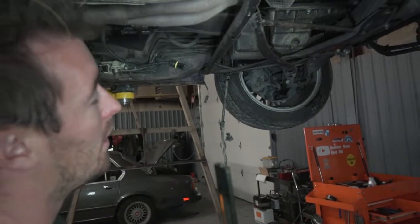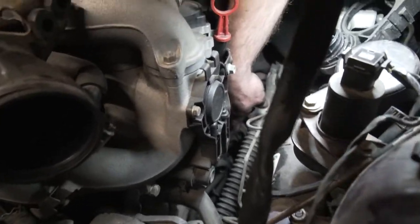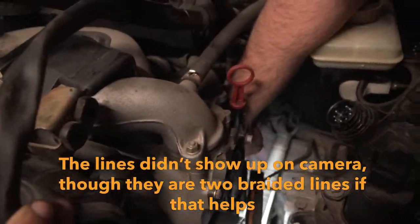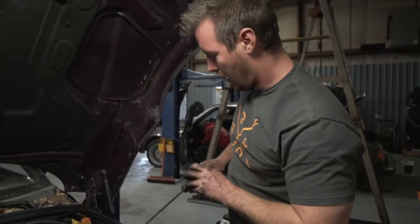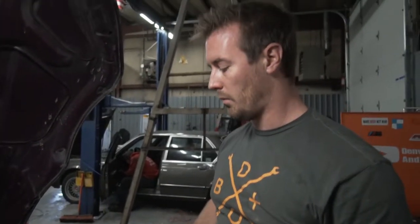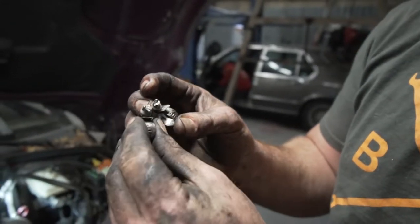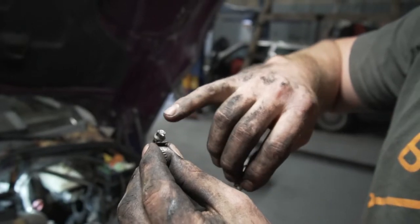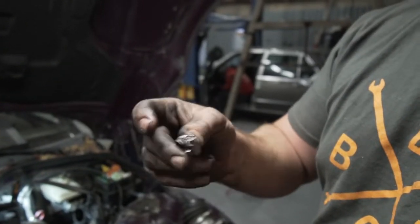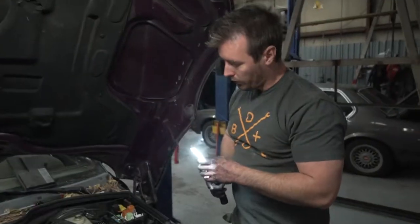Now that we've got our electronics done, we're going to go back up top and start with the fuel system. You'll find your fuel hoses running up from your chassis — there are always going to be two on BMWs as far as I'm concerned. Since we have disconnected our purge valve and both fuel rail lines, the fuel system should be completely disconnected. You're going to want to buy new hose clamps for these ones — if you look really closely, you'll see that they're tapered, so you can only remove them. There's no socket size that fits these and you can only open them, not close them. So throw these in the trash and buy new ones. Fuel system is disconnected.